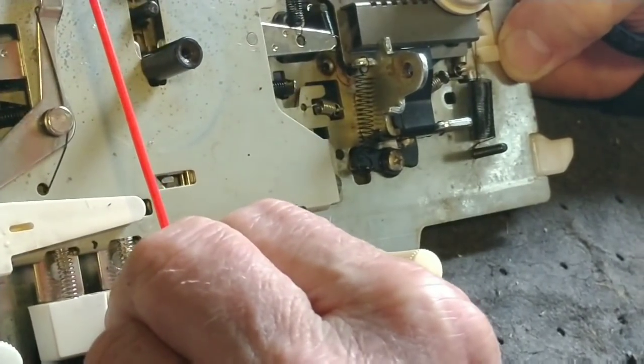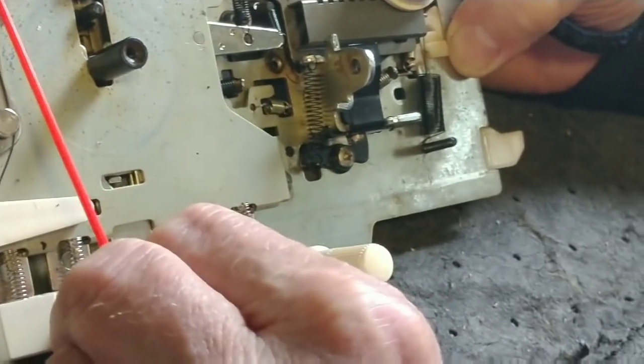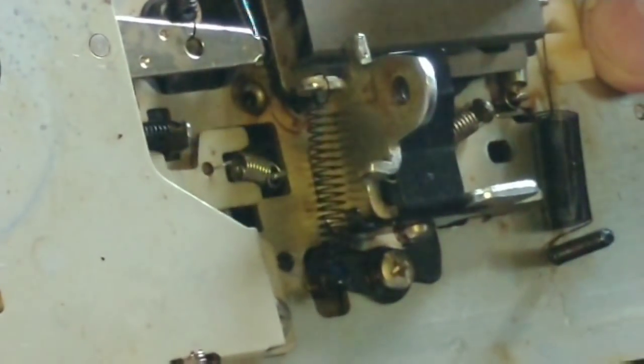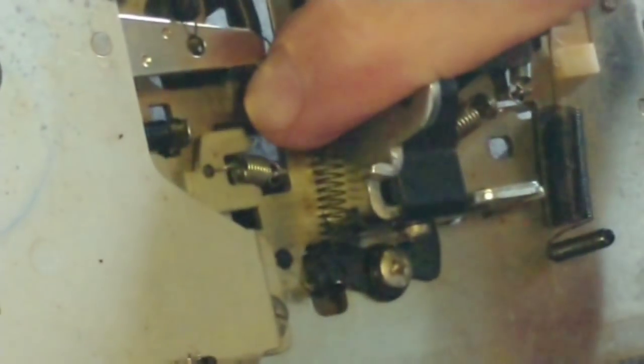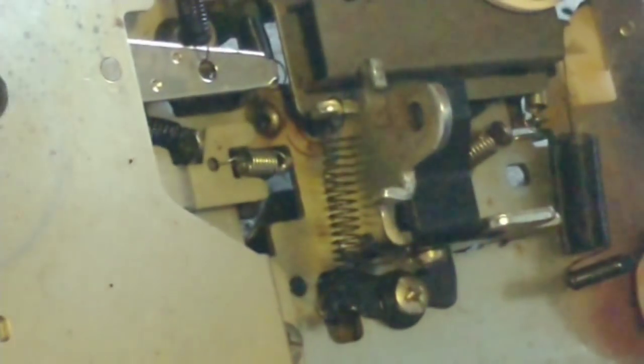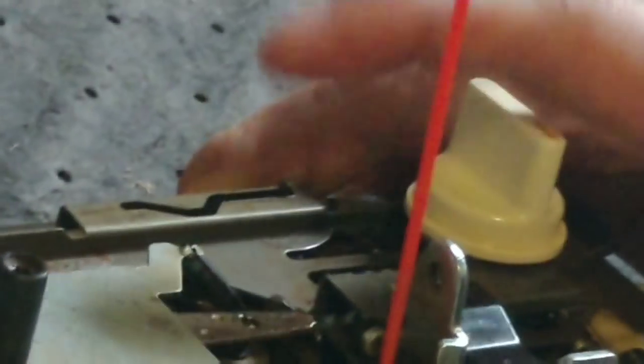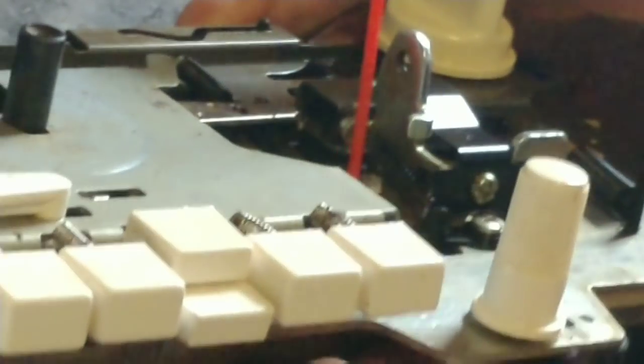The other end of the spring is on the flipper post. I'm going to cancel it and there it goes. Now I will do it again real slow — see that lever coming up. You see this lever coming up right here, and when it reaches its locked position, it's controlling this flipper. I'm going to point with the straw where we're going to look on the top. You see my straw going in — look where it comes up, right next to that spring, because the spring is on a post that the straw is following right on the end of this flipper.